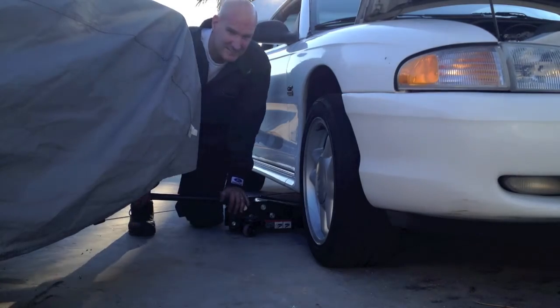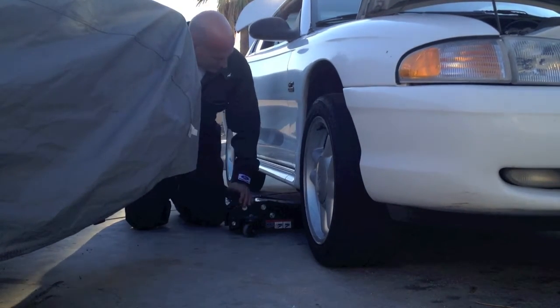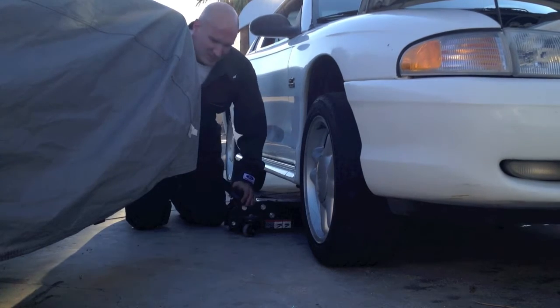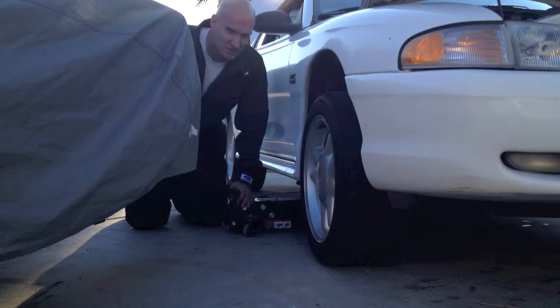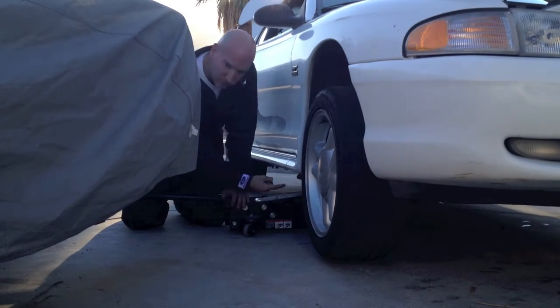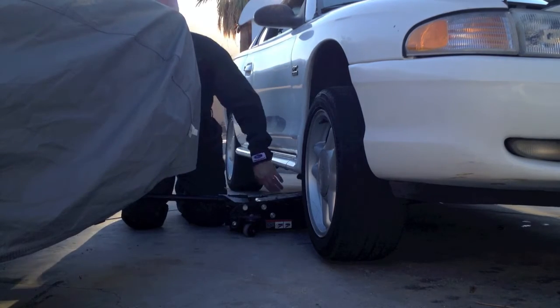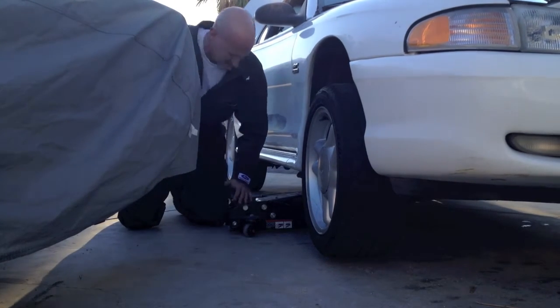This is kind of a back-to-basics video, but we show everything on Mustang Medic. We're doing a simple oil change on the GT. Basically, use your emergency brake, use your block on top of your jack so you don't bend in that underbody — which bends in really easy — get her up high and then get ready to get the oil pan underneath.